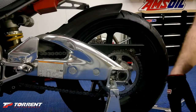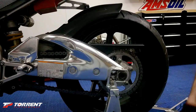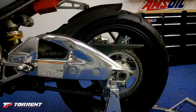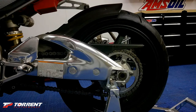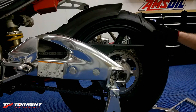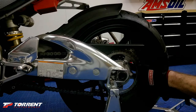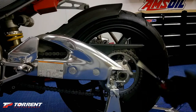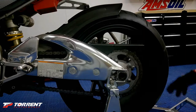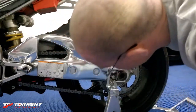Okay, we're going to get started here. I've already got the bike set up on the rear spool stand and what you've got to do is find your master link on your chain. On this original chain, I think they riveted the chain — when I replaced the front and rear sprockets before I put this bike into storage, the back one was really, really toast. But I put a master link chain on here. So you've got to break your master link off. The easiest way is to take a flathead screwdriver and pop that master link off. Then take it off the sprocket and pull it off.